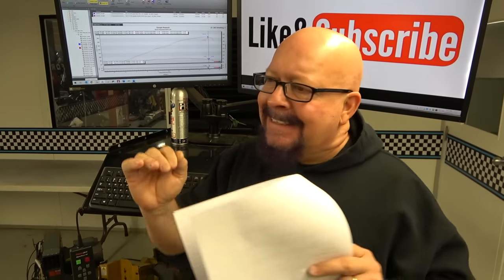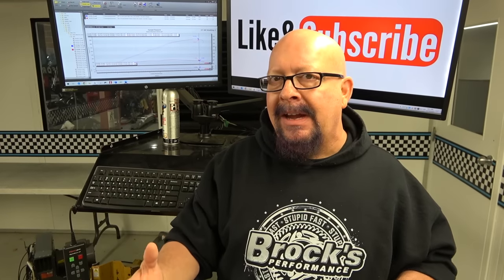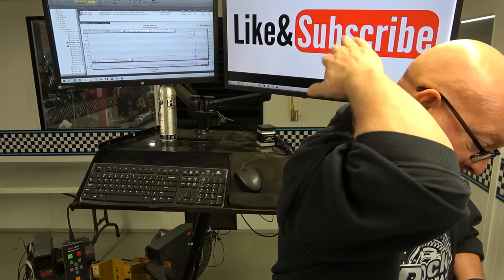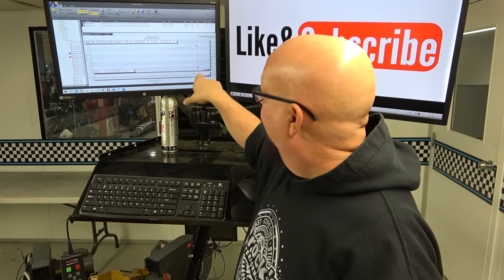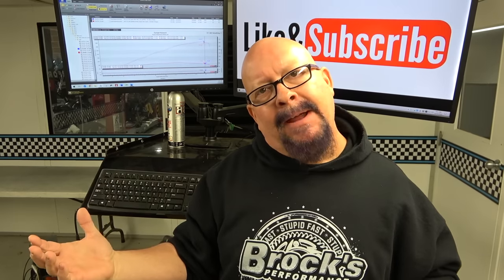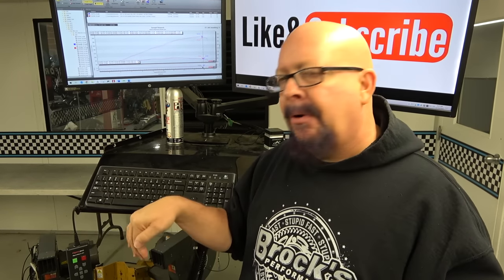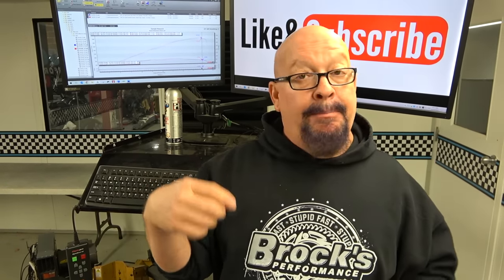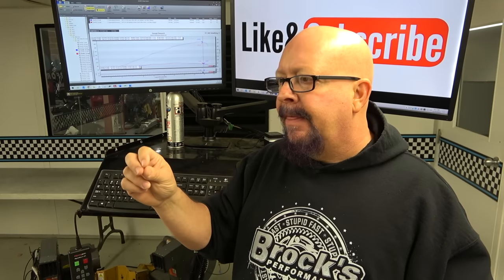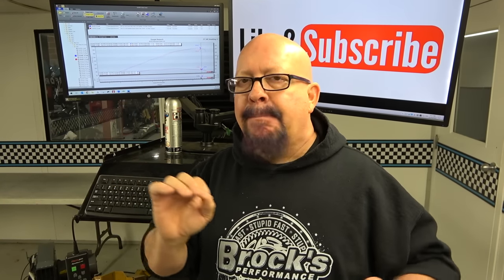Now, this is going to be really difficult for some people to comprehend. A lot of times what we see is maybe the bike won't have a really good, and you know, listen, I'm gonna go ahead and pat myself on the back and pat Dynojet on the back. Look how straight as an arrow those air fuel curves are. Okay, they're straight, but is that where the bike makes the most horsepower for the conditions on that day? What happens a lot of times is guys will throw their bike on the dyno, they have a certain tune in it, they put product A in there, and poof, wow, we've got 5 more horsepower. Well, did the product make 5 horsepower, or did the product mask a poor tune?